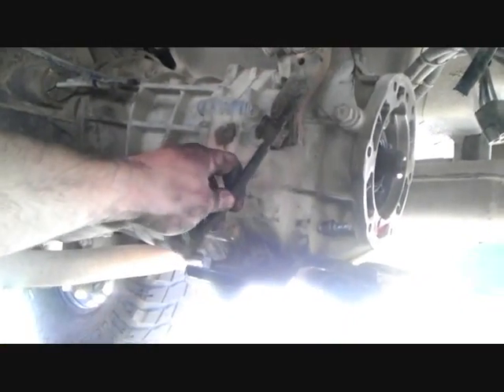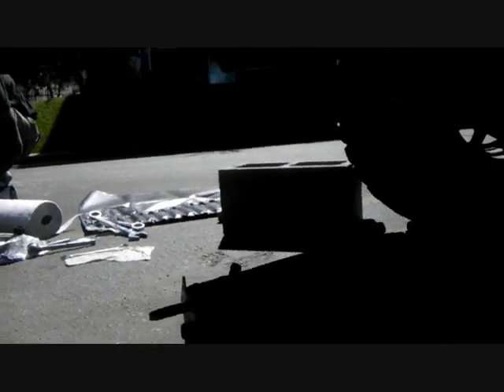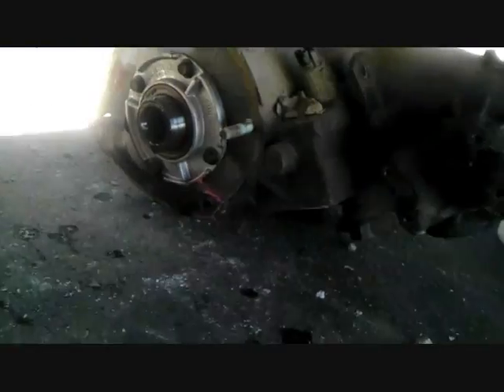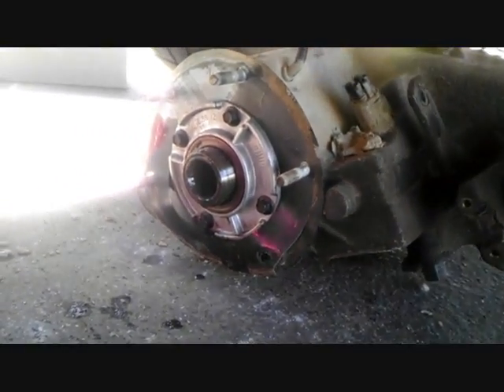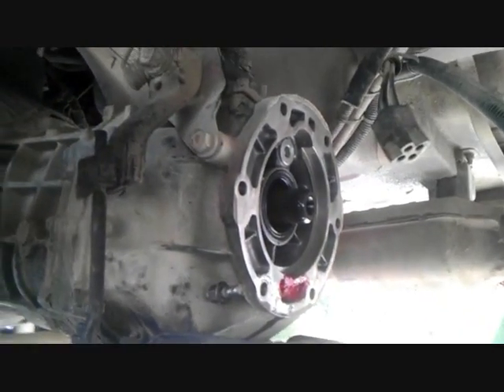Alright, so we pulled it off — this thing gave us a little bit of trouble. It plugs right into this little hole right here, so we just pulled that out. And here we have the whole transfer case. You can see those six bolts that were stuck inside of it. Pretty straightforward — it took two of us to get it out, it's a pretty heavy little beast. And that is how you remove a transfer case from a Jeep.